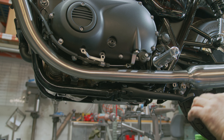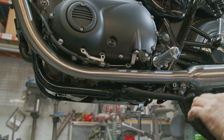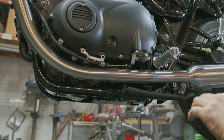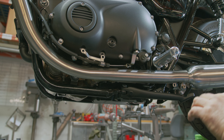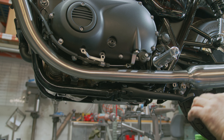If the gaskets haven't fallen out already, you want to remove your exhaust gaskets. I'm just going to put a rag in there to keep anything from getting in. Remove that gasket, stuff the rag in there. So next, with our 6mm Allen bit, take this clamp and loosen it.